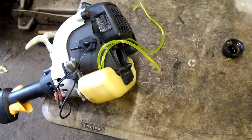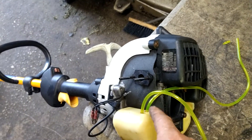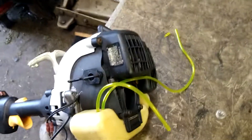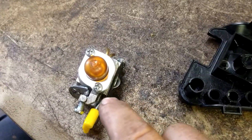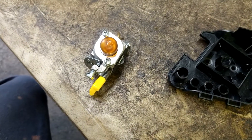The short one on the outside is the return line; the one on the inside is going to be your fuel filter line. I know it's opposite of the way they had it, but it's just easier to get to when you do it through this side. We're going to remove the fuel lines from the carburetor and get them off. Two Phillips head screws — take them out.